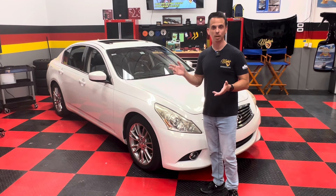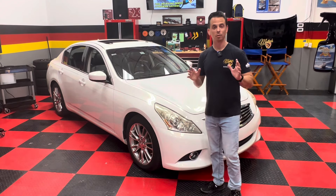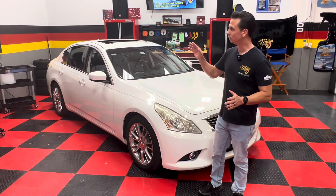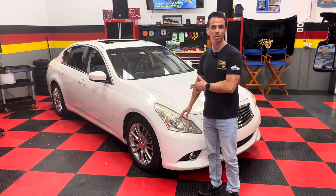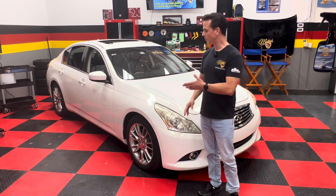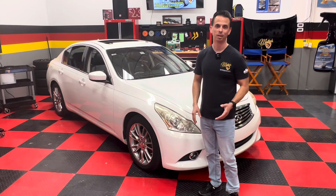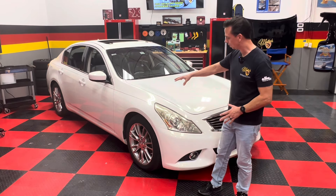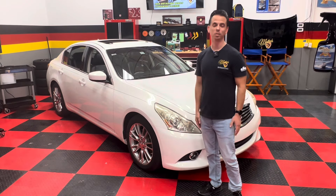For this video, I'm going to showcase a three-inch cordless polisher because I love my battery-powered dual-action polishers. The first step is the all-in-one headlight restoring polish, which is quick and easy. It's optimized for plastic headlight lenses, and then once I restore the clarity, I'll follow with the graphene headlight coating. That'll put a blanket of clear coat protection over these headlights to prevent them from yellowing, fading, and oxidizing over time.